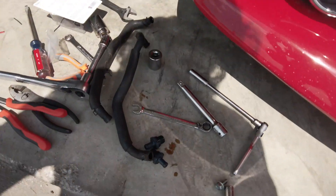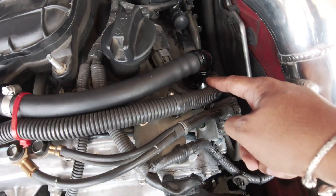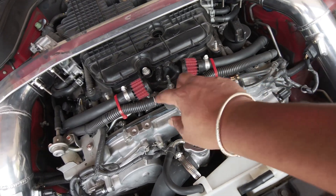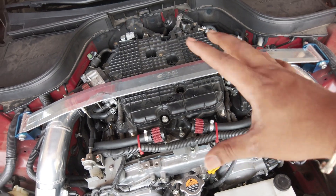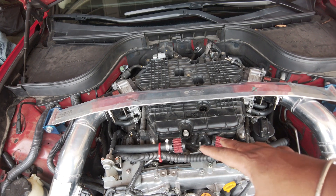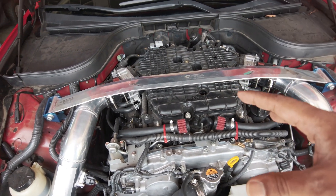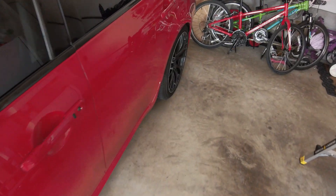And there you have it — we're all done. We've replaced the factory PCV valves and inline tubes to the manifold, put on the adapters, threaded in our fittings and vents. We've capped and zip-tied the inlet manifold ports so there's no vacuum leak — that's the crankcase inlet — and we don't want unmetered air going into the engine. This is venting the crankcase up to atmosphere for now. It's a temporary solution because eventually I'll get blow-by and crud building up. I'm still figuring out which catch can to go with. Let's start it up and see — no more vacuum.